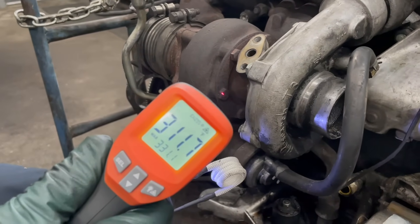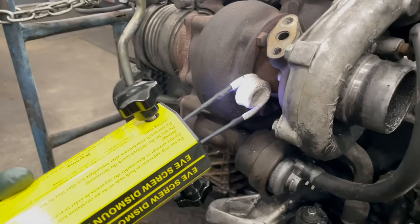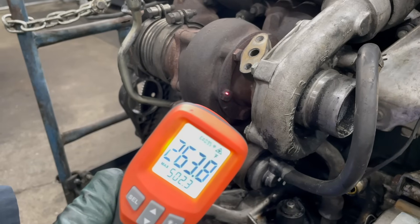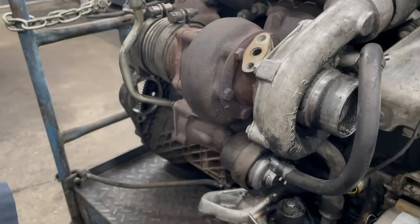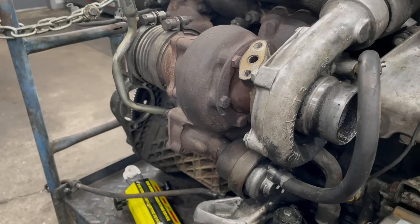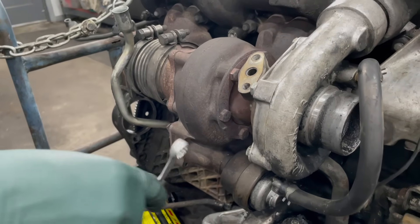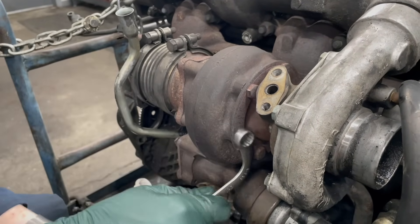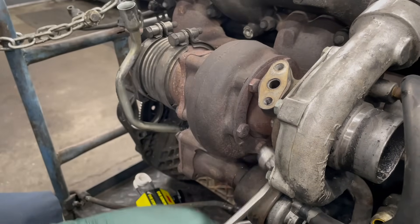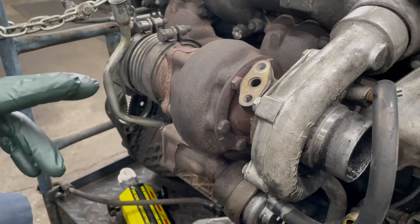Checking again — we're up to 313 degrees. Just a little bit more. Okay, we're up to 400-some degrees. I'm going to set this down, take the wrench — this will be interesting because I'm not even going to really torque on it. Just grab the wrench and see how tight this is. Look at that — it just loosens right up. Now be careful — you probably want to wear leather gloves when you do this. But this is the best way I've found to get these stubborn bolts out if you can't get them to budge with a normal wrench.